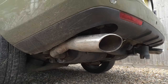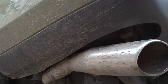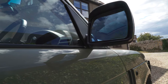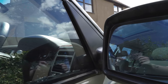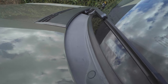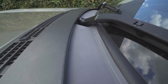Our car was tuned and modified by Overfinch from new and has their custom back box exhaust fitting. This really enhances the V8's burble and is part of the engine tuning package that was originally specified. We are going to restore the tailpipes to showroom condition and replace the rusty exhaust fittings just to enhance the overall look. With early cars approaching 20 years old it's really useful to check the wing mirrors are still fitted with the correct glass. Both of our mirrors have been fitted with incorrect aftermarket replacement glass such as found on eBay. The L322 makes use of lots of external trims, and on this car the windscreen scuttle panel has faded quite badly and the paint on the bonnet vent has started to chip and flake away.